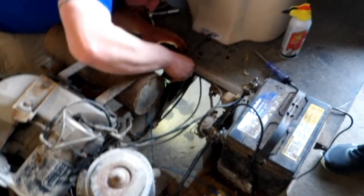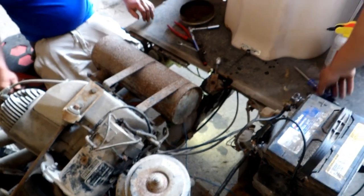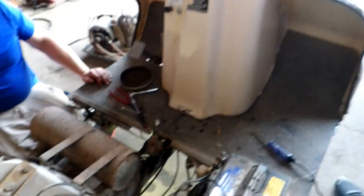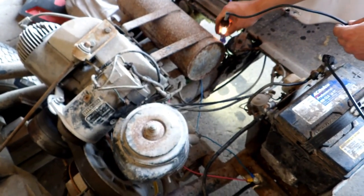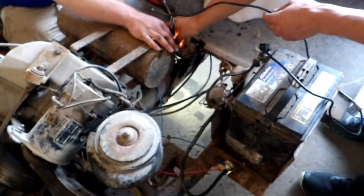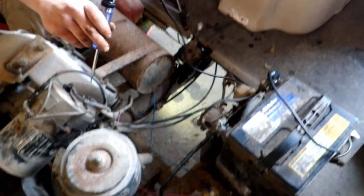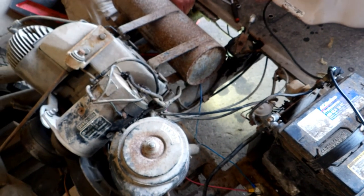Like I said, we ran in an extra ground. I still got to put a toggle switch in for the main key — that's just a jumper in the front there. We're going to try to give her a full send. We're basically checking for grounds with a test light. That looks much better. Because like I said, we're getting heat, so we've got some dirty resistance.